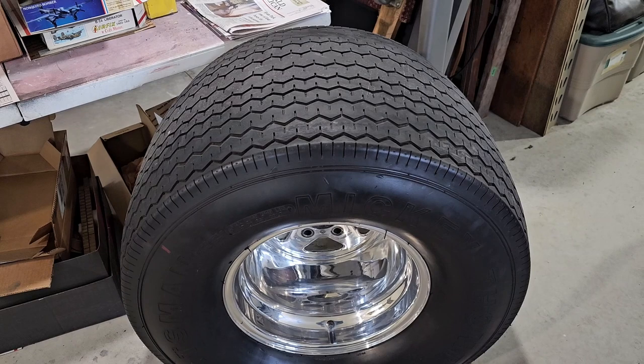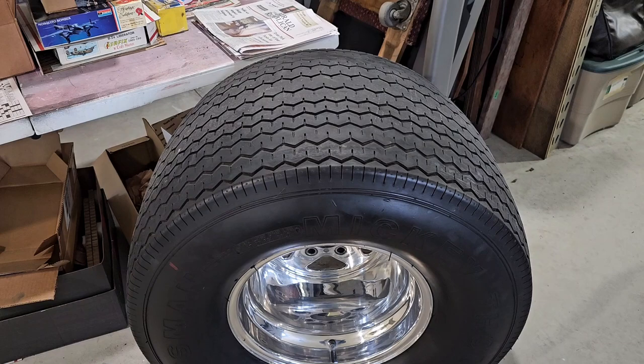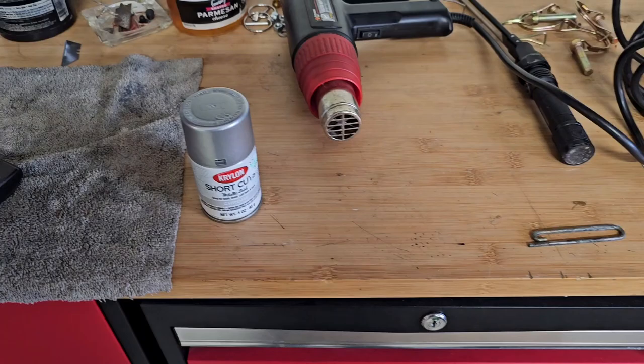These tires are probably 20 years old — they're not really worn but I don't really trust them, and they're actually a little too wide for the car. It looks cool though because you've got the steamroller effect when you take a picture from the back. I'm looking for something on the order of a 14x32 stiff sidewall slick — cheater slicks or a DOT slick would be even better. You need the stiff sidewalls because when you drive on the street and turn a corner with soft sidewalls, that's not good. They don't make the Sportsman Pro anymore, and Hoosier has a QuickTime but not in this size. So that's another project and another thousand dollars I'm gonna have to throw at this car.